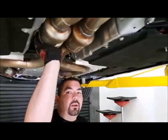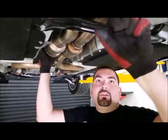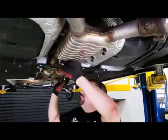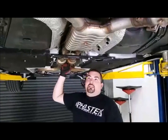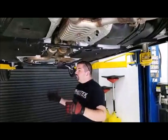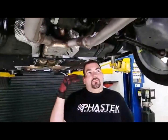Here's what's a little special about the six-gen V6 cars: the secondary cat is actually right back here in the center of the car. A lot of manufacturers will put a larger resonator instead of putting the cats way back here — they'll have the secondary cats a little bit further up by the transmission. But the V6 cars put the secondary cat back here and the resonator a little bit further back. That's kind of where the cat-back comes into play, but today we have an axle-back.